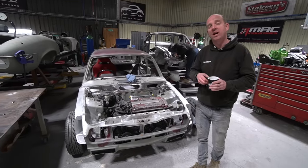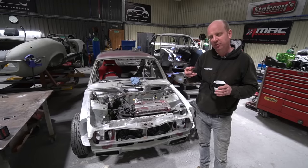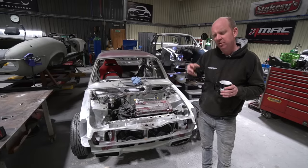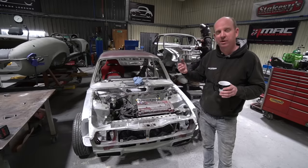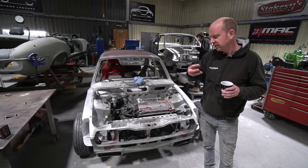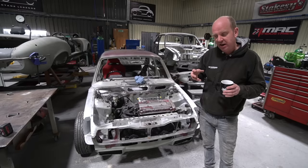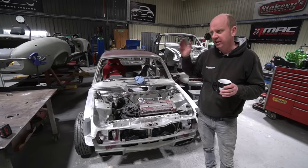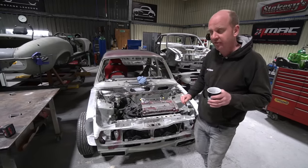On this Allegro we'll actually be able to use a standard off-the-shelf Honda hose set, so it's a bad example, but going forward it could be a really useful process. I wasn't aware there was a readily 3D-printable material that would withstand between 200 and 300 degrees C in an autoclave. At the moment we tend to use straight sections of hose and aluminium fabrication for one- and two-off coolant systems. If we can use 3D printed mandrels and make a hose set plus a couple of spares for a project car, that's a really neat solution — gives the customer spare parts and it looks like an OEM part.